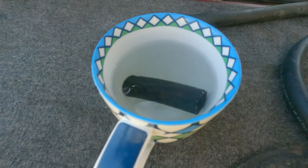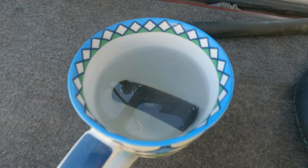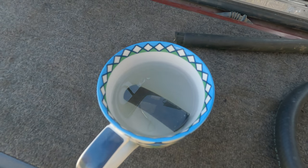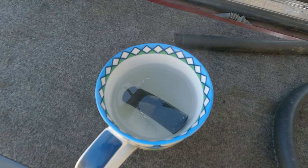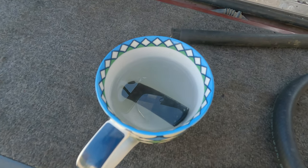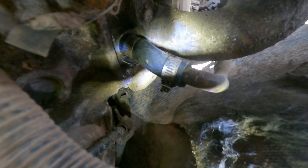To make life a little bit easier I'm soaking the hose in hot water because it's in such an awkward spot — that'll soften it up a bit, then we'll get it on and do it up. There it is, just done up. As you can see, that's the position of it. Looking from here it's right up in there — very fiddly. That big wire was sort of in the way; I didn't want to take it off, but if I had it would have been a bit easier.